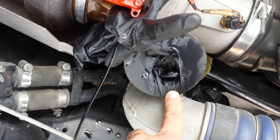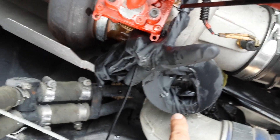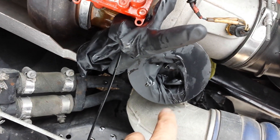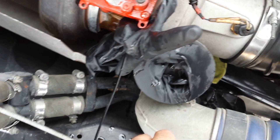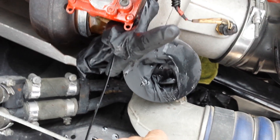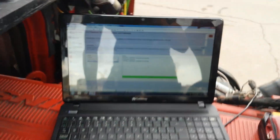Also, you have to make sure you always block off the turbo opening — I use the glove again as a tool. Just make sure you put it over this opening and don't let anything go inside your turbo. They are very pricey and you don't want to leave any tools inside. I'll go ahead and button this up, fire it up, and we'll see how it runs.